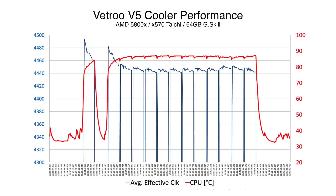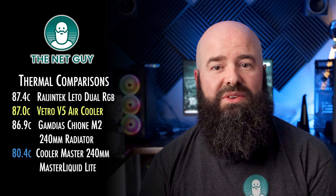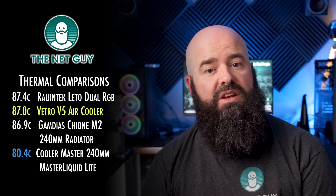So let's talk about benchmarks. This cooler gives out some very impressive numbers right off the bat. For the AMD 5800X, if it hits 90 degrees Celsius the CPU automatically starts to throttle and lowers boost clocks. With this cooler, I ran several Cinebench R23 sessions in a controlled environment at 72 degrees room temperature. The 5800X got up to 86-87 degrees after a very long run, with a stable effective clock speed of 4,450 MHz. This would be an unusual torture test, as you rarely run a CPU like this for long periods unless you're encoding videos. What's amazing is that the cooler did this while being nearly silent at low speeds and only barely noticeable on full blast.